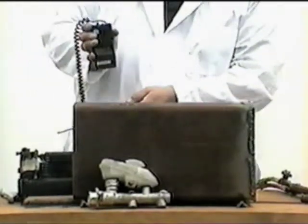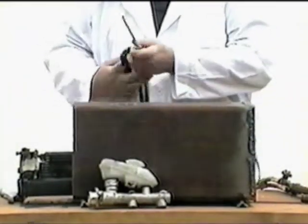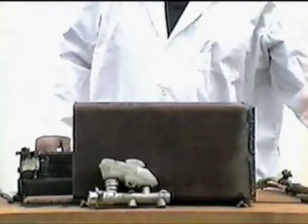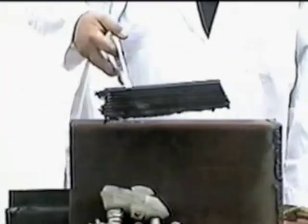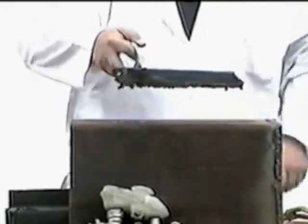The temperature stabilized out at about 720 degrees. So it takes a little bit more temperature to destroy the area where the header joins the side reinforcement. Again, we can see a pretty fair amount of destruction at a fairly low temperature. Under normal circumstances you should see some type of destruction, but it'll be on a progressive basis. If you look at the radiator, one end has been subjected to pretty high temperatures; the rest of it was in the same oven area, but the scorching is fairly minimal.